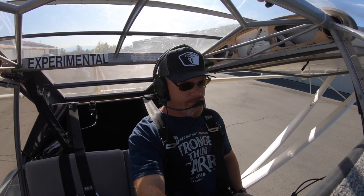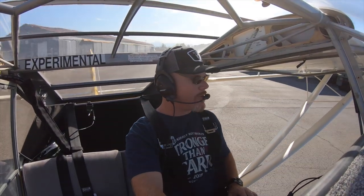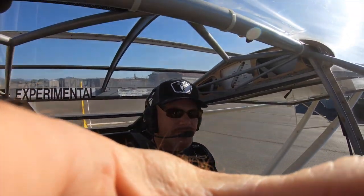We are taxiing out for brake test number three — the all-Behringer system. It was a pretty fun install, picking up those nice stainless braided brake lines. It's not a very complicated switchover. The most difficult thing was getting the old masters out — taking the cotter pins out of the castle nuts was a little tough to get to in some spots. It's probably a lot easier to do while you're building a plane without the firewall forward on there. I'm going to keep that in mind on my new build on the 7 and install the brake lines before I close all that in.